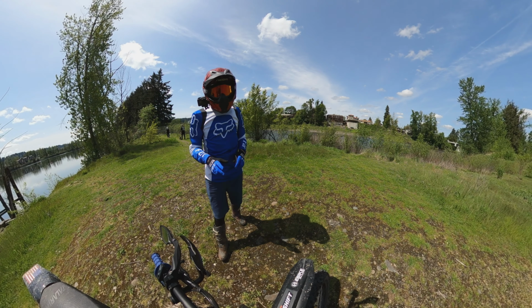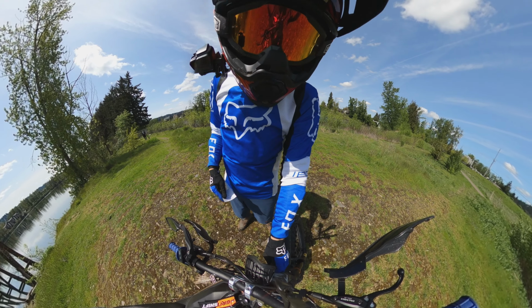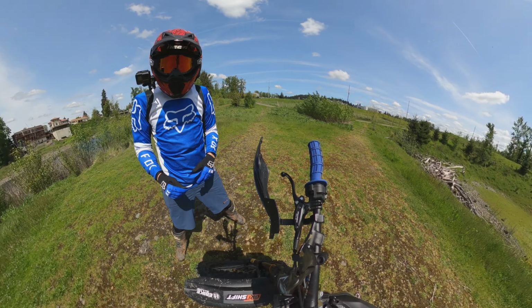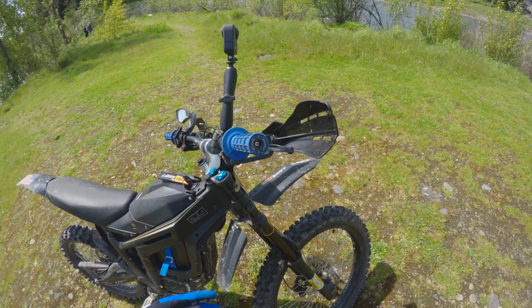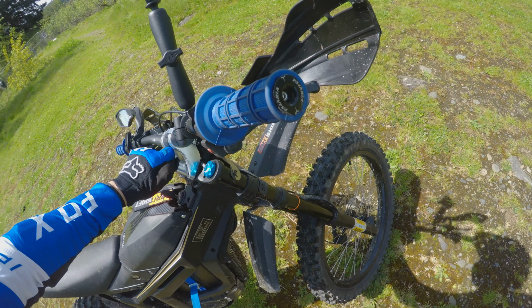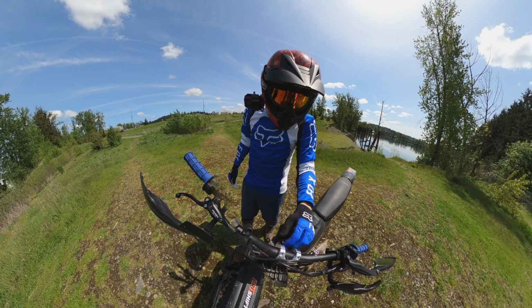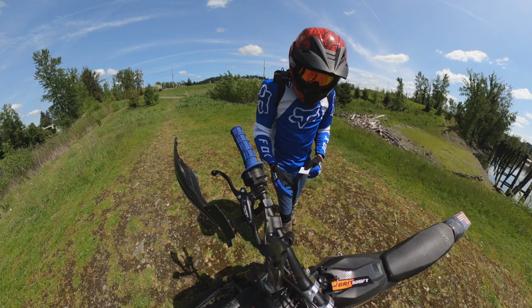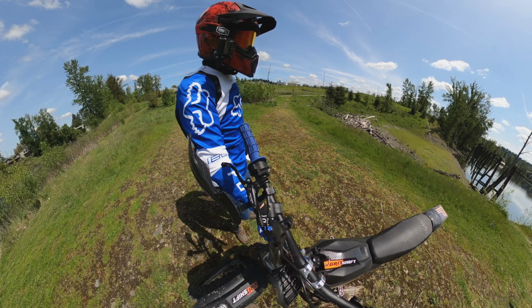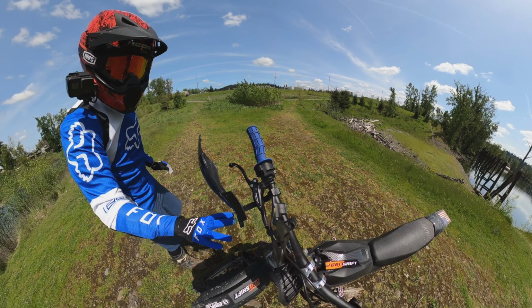The fenders are super solid now, and the best part about this is, now I know some of you have this fender already, and you know it has a little plug that goes up below here. So what I've done is I've gone a step further and put all thread all the way up through this and double nutted it here. That's the ticket. Then I trimmed it out with a little cap here, but it's double nutted down here, and then all thread runs all the way down here to a lock nut. This is a bulletproof setup now. This is not going anywhere unless this all thread snaps in this neck, which it's not going to. There's not enough force on it, so it's solid. It's not going to fall off. There's no tie straps or any of that crap holding it up.